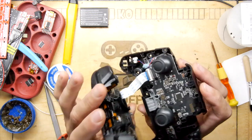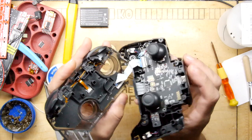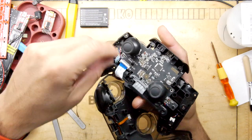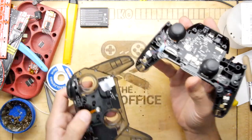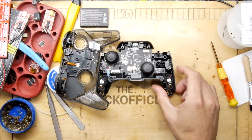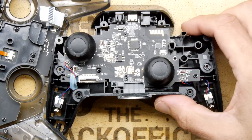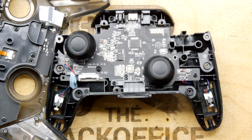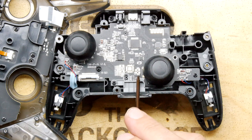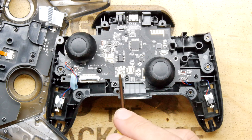That is very fascinating - look at that, amazing quality. You actually have a front PCB here and a back PCB and a little ribbon. This is alarmingly well made. If you think of all the functions these things have, they are almost like completely independent computers themselves. And what's fascinating about this one - it's got extra hardware here: a space for a timing crystal, another probably microcontroller, diodes, resistors, capacitors. There's your antenna, which is Bluetooth.